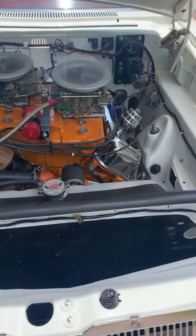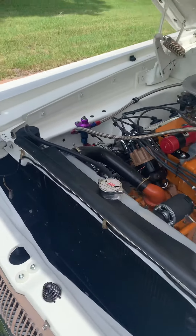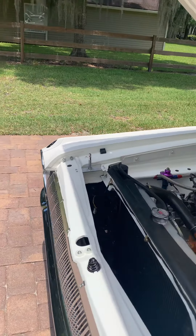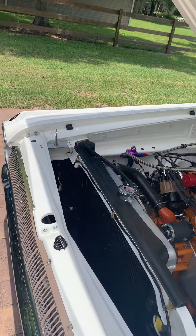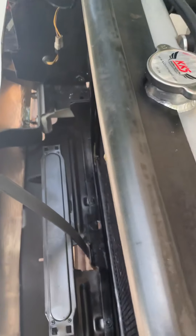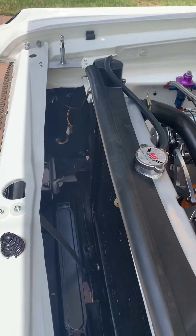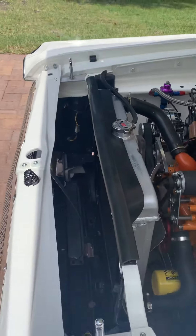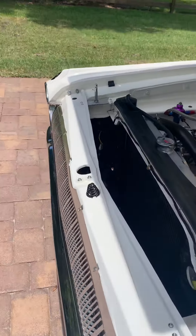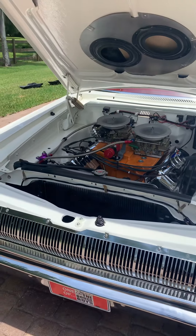When I got the car it had an oil cooler mounted way up at the top of the radiator, and the installation really wasn't good — it used a big piece of flat bar and it was kind of ugly. So I've reconfigured all that and actually mounted the oil cooler down on the splash pan below. It looks real good, it's out of sight out of mind, and it'll still get plenty of airflow for the amount of time this car will be driven on the street or any long distances.